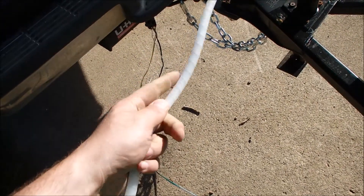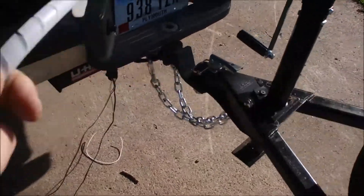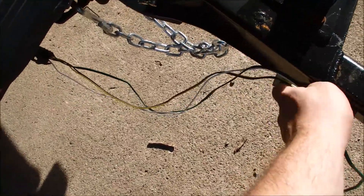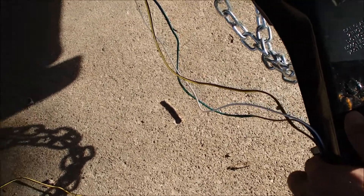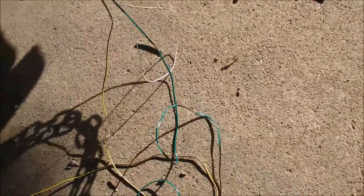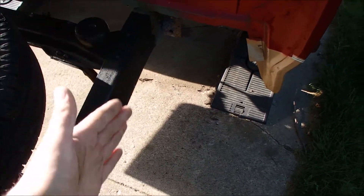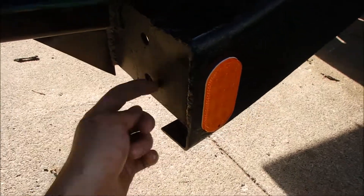With this spiral wrap you just unwrap it and wrap it back on. You just spin it around the wire like that - pull it apart and start wrapping, wind it around. You want to leave yourself enough slack. I usually say as much slack as the chains have is how much slack you want in your wiring, because you might pull it with a different vehicle or when you turn you want enough wire so you don't pull the plug apart. Now the biggest concern with running wires on trailers, especially home built ones, you want to keep the wires from rubbing up and down or side to side on frame members. Like if I go through here and go through this hole, I'd want to put a rubber bushing in that hole or run it through this spiral wrap stuff.